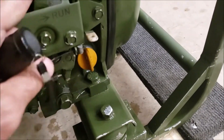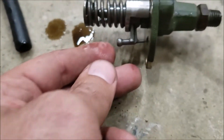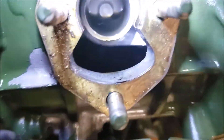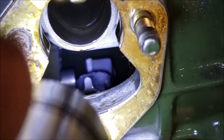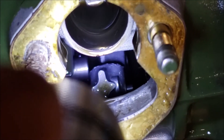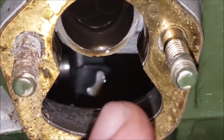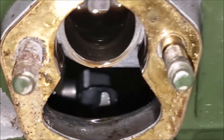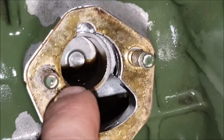It wasn't shutting off when I hit the kill switch. Like what happens a lot with these motors, someone didn't put it together properly. You can see how this is bent a little bit but it moves. When they put it on, they actually broke the governor fork off and it's probably sitting at the bottom of the crankcase - yeah, see there it is, snapped right there. With the governor fork broken and stuck in the on position, the only way to kill it was to decompress the engine. As it runs, it moves the little lever on the fuel to on. The governor goes back and forth to actually pump the fuel on that spring.